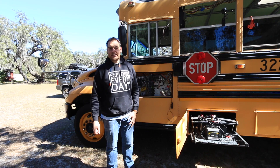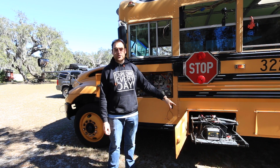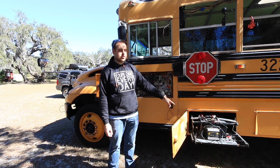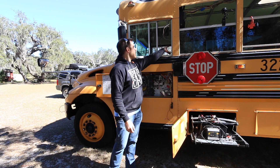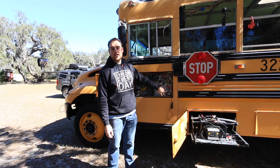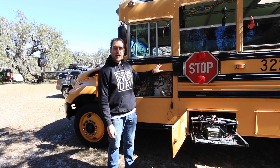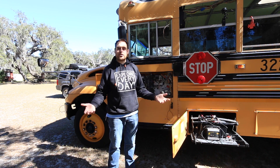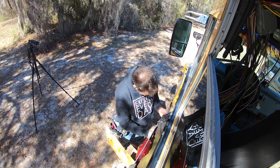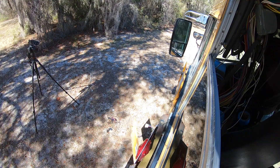I'm out here at the electrical panel for the bus. I've also got the batteries out, so the first thing I'm going to do today is detach those batteries because I know these wires here are what I want to take out. That way, if these are connected somewhere live, with the battery disconnected there'll be no energy in the system and we should be good to just take them out. So that's the first thing — disconnect the battery and then start figuring out where these wires connect in.